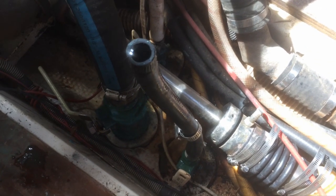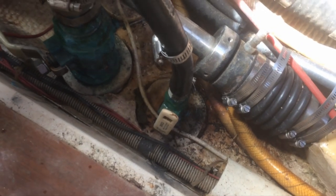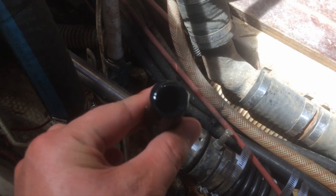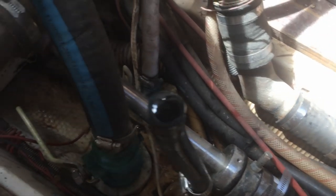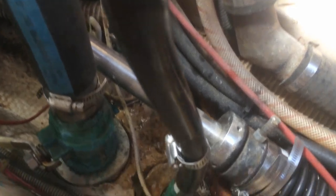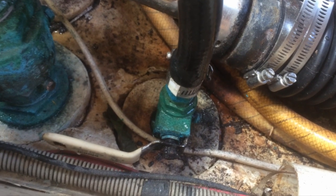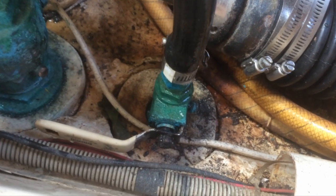Currently the way this was plumbed, I just detached the hose from the raw water strainer, but I opened the through-hull valve here just to show that the top of the hose is actually below the waterline — water is coming in right now. This is definitely something I want to fix. I want to bring this hose further up above the waterline so water won't come in, and of course once I close the valve the water stops coming in.